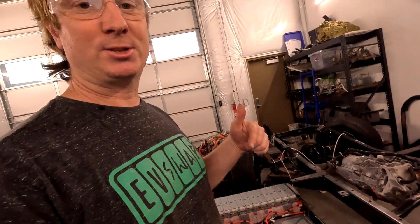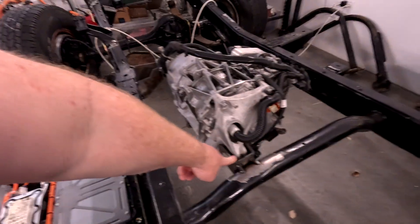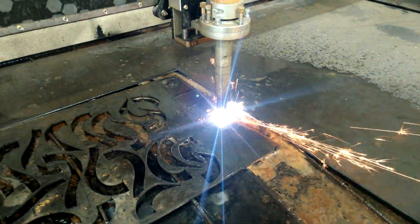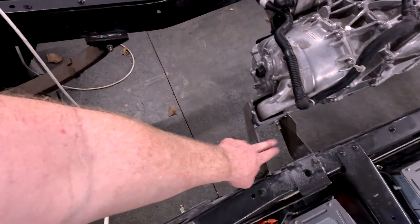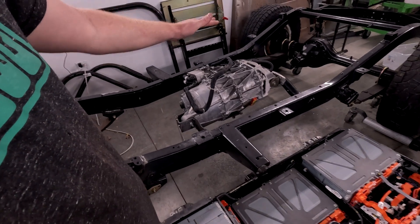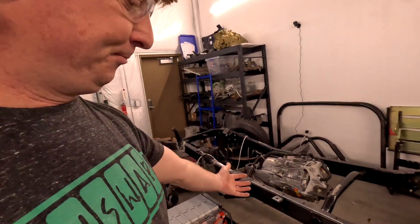Moving to the Land Cruiser — last week I talked about my cardboard-aided design and computer-aided design. Well, I turned those CAD files into steel. My buddy Woody at Electromod Garage has a plasma table and he plasma cut these motor mounts. This is where the Tesla motor is going to live in the chassis. Right now it's just tack welded because I'm still not sure on the final height — it may need to go down or up a little. The output from the motor lines up with the drive shaft front and rear, and it's all supported by the custom motor mounts. I was really surprised my first draft actually worked well enough to tack weld into the chassis.